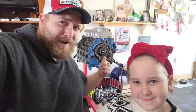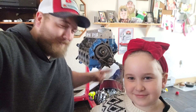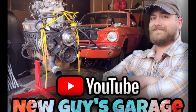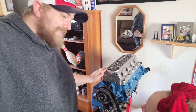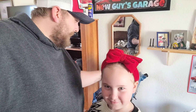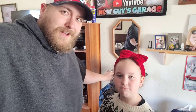Major success - we're finally getting somewhere with this thing. I got it mocked up and I can't wait to show you what we found. As you can see, we have this whole thing mocked up here. I did, and I have since un-mocked it because piston-to-valve clearance is the big thing for today, and there's one other thing that surprised me a little bit.